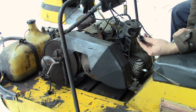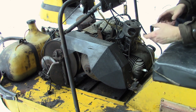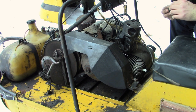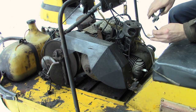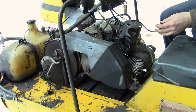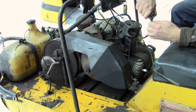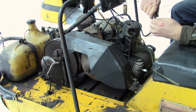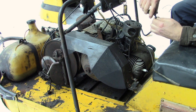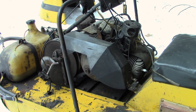This guy has the small hole. Basically, you have to unscrew a little lug on the spark plug. Again, the cap still looks okay, so we'll do the same technique. We'll just clip off the tip and get this guy on there. You can see how it's not the most effective way of holding a wire to a connection, but that's what we got.